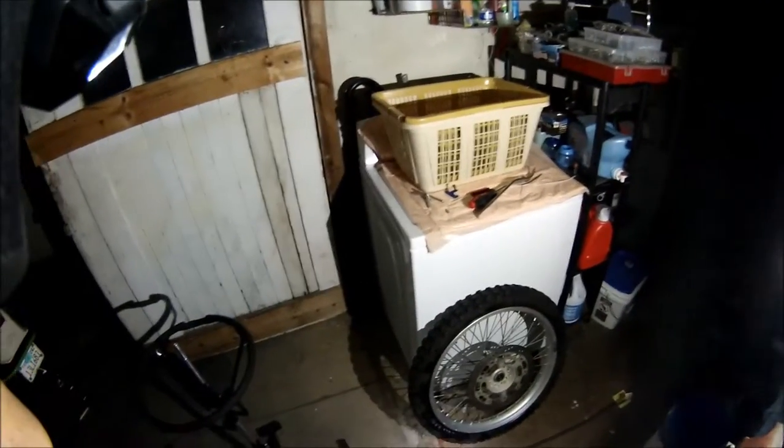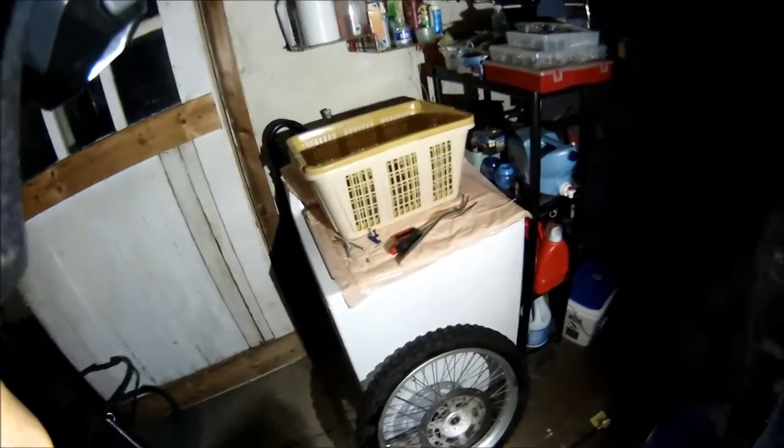Done. Just go ahead and tighten this — it loosened up a little bit again. That's good to go. Can't believe how easy that was — I didn't even break a sweat. Without the rimlock it's a piece of cake, I'll tell you that. The rimlock is a real pain in the ass to work with, but once you learn to work with them it's not too bad. Now I need to balance the wheel. If you're just going to ride purely off-road you don't need to balance it, but I'd suggest you do if you ride on the road, especially on the freeway.